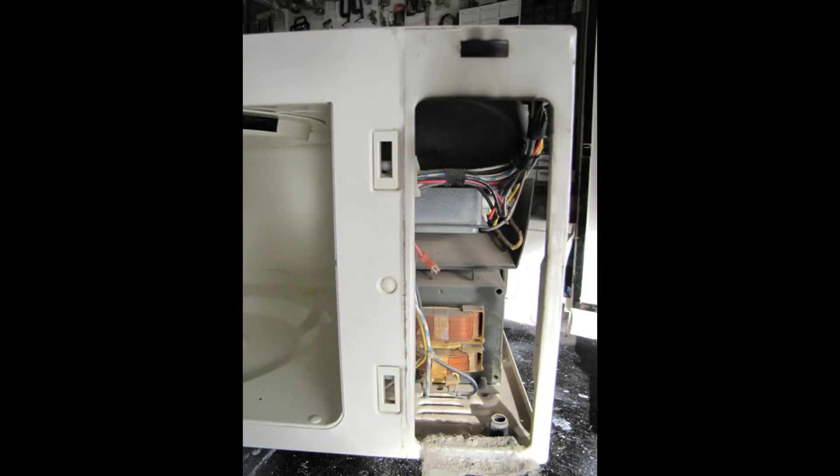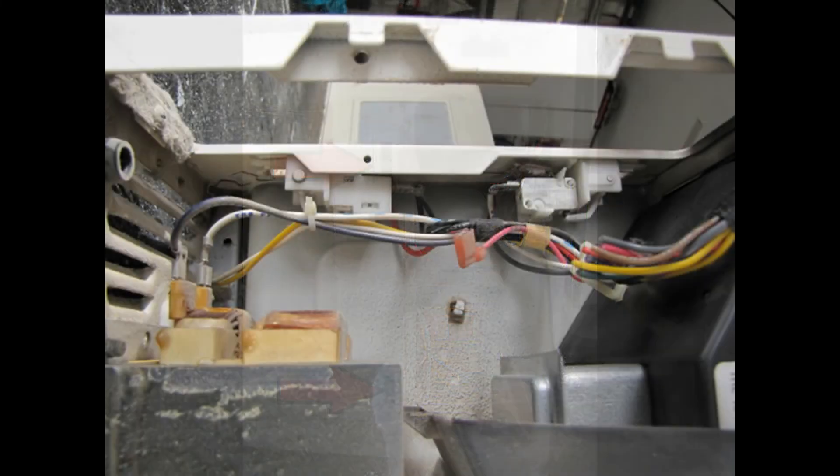After removing the door, you'll see these two slots right here. Located in those slots are two, and sometimes three, microswitches. They come in very handy for little projects. As a quick side note from when I used to repair microwaves — many microwaves that aren't working anymore is because these switches are out of alignment from people slamming the door. It's important for the door to be closed while the microwave is in operation, so they have two to three switches to make sure.